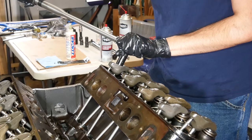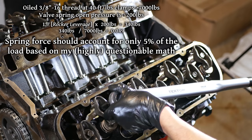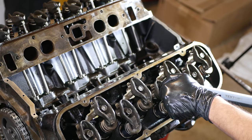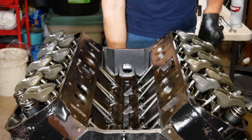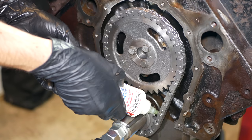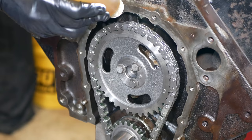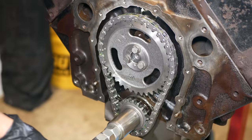For now we'll be retaining the net lash setup, and with all of the rockers in place we'll go through and torque all of those to 40 foot-pounds. It would definitely be more ideal to torque these while they're on the base circle of the cam, since the valve spring tension could prevent the bolt from getting to full torque — so it's certainly not the best practice and not what I would recommend — but with these low-strength valve springs it probably doesn't make a lot of difference. After doing that for every one of them, we'll turn the engine over a few times and make sure everything is moving correctly between the pistons and the complete valve train. We'll also take this time to oil the timing chain since we hadn't up until now — putting some assembly lube on the sprocket teeth as well as the chain, turning it over a bit, and pouring just regular engine oil over the chain. That should be plenty to keep everything oiled as the engine starts up.